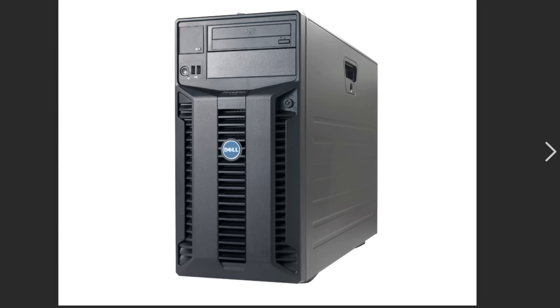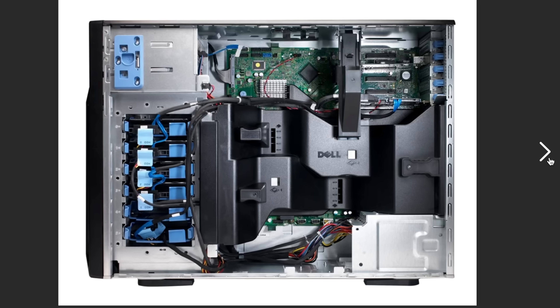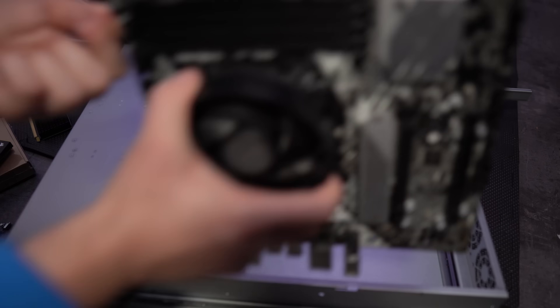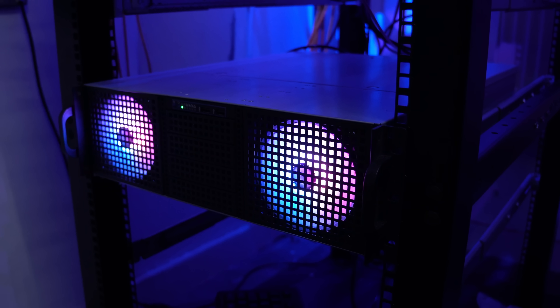Modern generation CPUs really make a huge difference here. From my own experience, I once bought a Dell PowerEdge T410 — probably 10 or 15 years old — a small tower server based on professional server equipment, which I used for my very first home lab build. But when I compared its power usage with my desktop gaming PC, I found that in idle mode the Dell PowerEdge actually consumed three times the power of my desktop PC. So I got rid of the old machine and turned my gaming PC into my new home server.